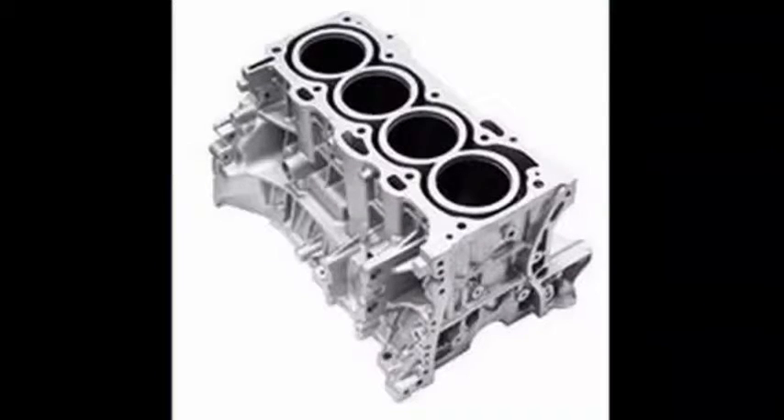If you have a cylinder that's significantly down on power, you need to look at that particular cylinder and find out what's going on. Also, if you have two cylinders right next to each other that both have low compression, that's normally caused by a head gasket failure. The gasket fails between the two cylinders, compression goes back and forth between them, and those two cylinders will both be down. So two adjacent cylinders similarly low on compression is a good sign that's what you're looking at.